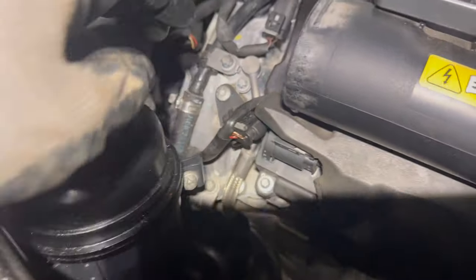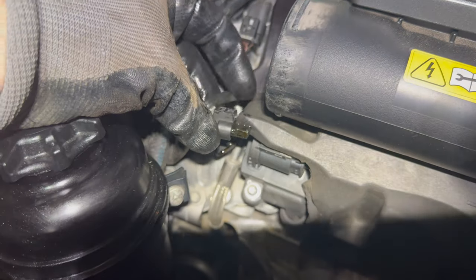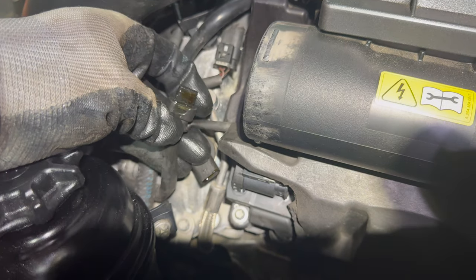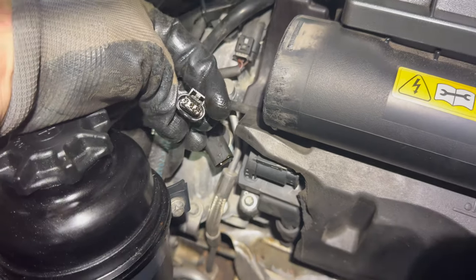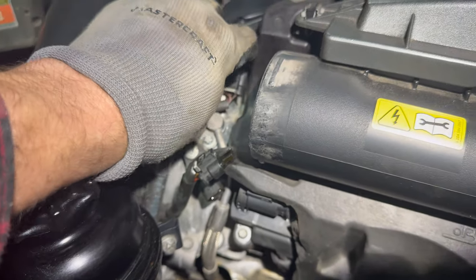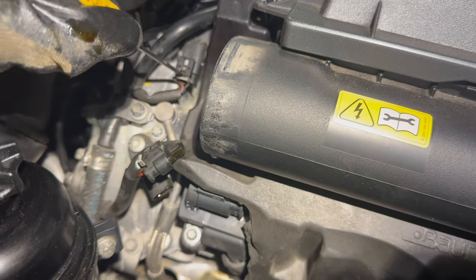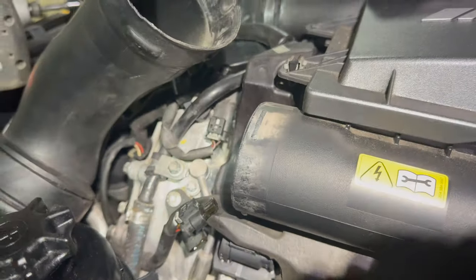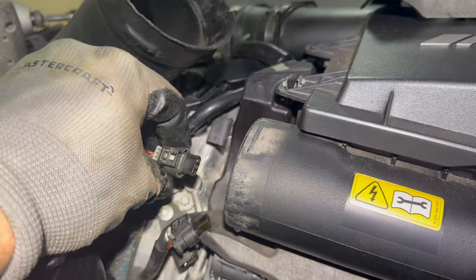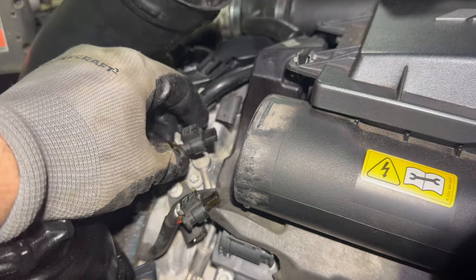On the driver's side, the sensor looks dry on the outside, but when I pulled the connector it's also oily on the inside. So the sensor is leaking oil on the inside of the connector. It's a good thing we're changing them all — even though these look dry from the outside they're still seeping. Out of the four, just one is dry for the most part and three were oily.